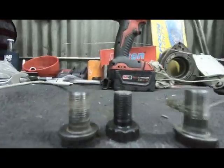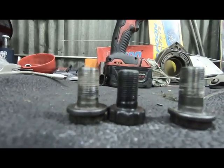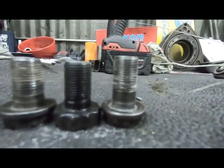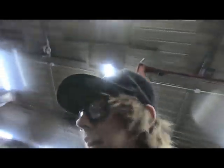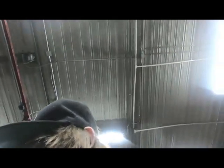Pretty excited for more. Both Mario and Jordan - the short block here - I got the pistons and rods all in it, torqued down, spins really good. Barely any force spins it - just pushing with my finger and I ain't hurting my finger or nothing. Spin it back around to TDC right about there. Piston number one is right up. That's why you'll see guys sometimes stick a wire in the spark plug hole in number one - they feel for this to come up, because if you go a little bit past, that starts to go down.